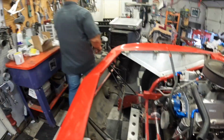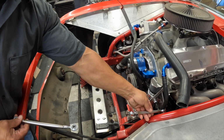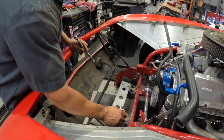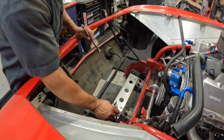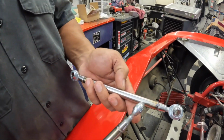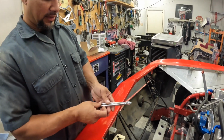We got the tie rods done. These are going to mount to this position here. It's going to control the radiator horizontally, so it doesn't move backwards or forward. Then we're going to tie those into these frame rails here, and that'll hold it down and keep it from moving around on the base. So it'll be one there, one here, and a repeat on the other side. This is stainless, 1/2 inch, 58 thousandths wall, with 5/16 tube nuts welded on both sides, machined down. So that's done. We'll need to make 2 more.